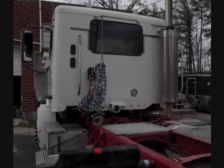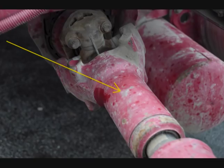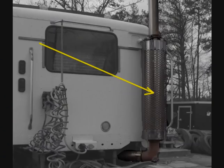Check the area right behind the cab of the tractor and check the underside of the tractor. Check the frame to confirm that there are no cracks, broken welds, holes, or other damage to the longitudinal frame members and cross members. Check the drive shaft to ensure there are no bends or cracks and that the couplings are secure and free of foreign objects. Check the exhaust system to ensure there is no damage or leaks and that it is connected tightly and mounted securely. Rust and carbon soot are signs of an exhaust leak.